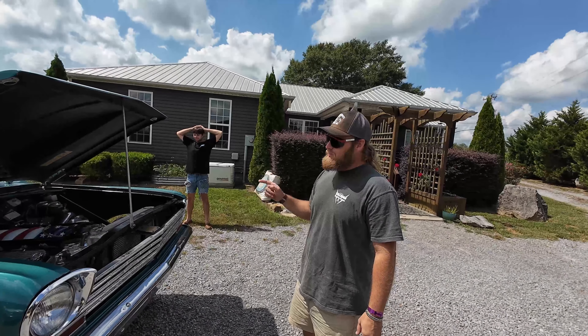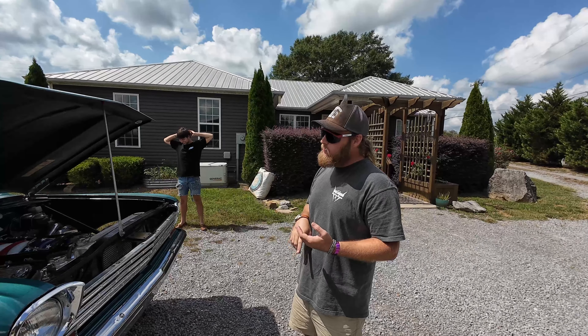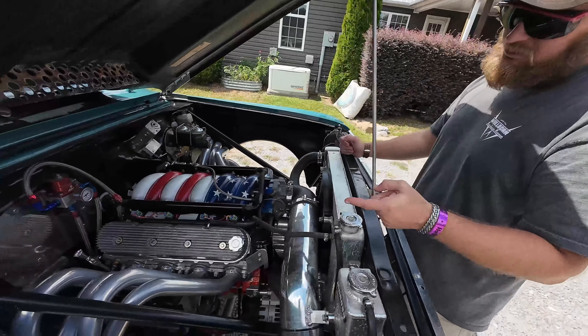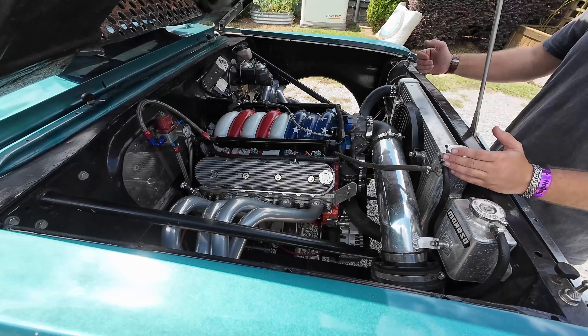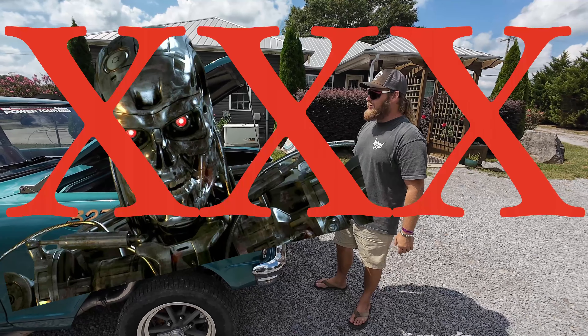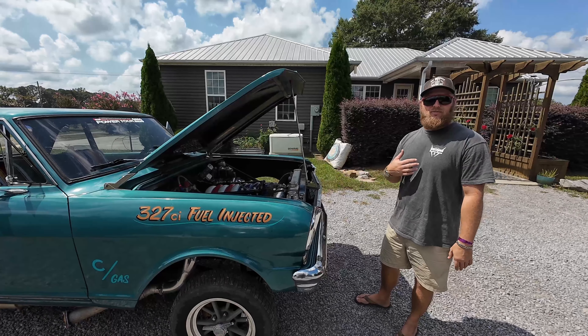It's a Gen 4 LS Suburban short block. It's got a ported Tick oil pump, a swap pan — Chinesium swap pan. I'm not going to pay for a Holley that's made in the same plant for twice the price. Doug's fender well headers, a set of 243s that I ported. It's got a Tick Polluter V2 cam, titanium retainers, did a bronze bushing kit on the trunnion on the rocker arms. LS6 intake, ported stock throttle body, 456 gear, T56 F-body trans. It made 370 wheel on a hot day in June. I tune it — it's on a Holley Terminator X.